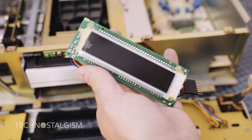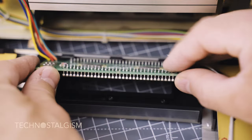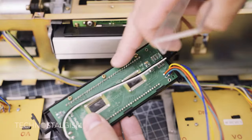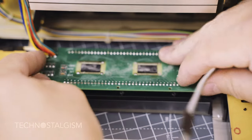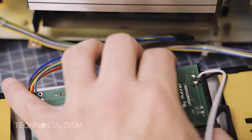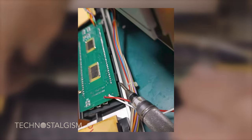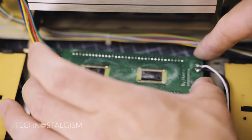With this sorted, it's time to remove the protective film and get ready to swap the display. And here's where I struggled a bit, as the new unit is a bit thicker, probably because of the added backlight. It can be pushed in with a bit of force to be held in place by the clips on one side and the screws on the other, but the board feels bent and I fear it might crack over time. After fiddling for a bit and trying to fit the board, I remembered that this is a Revox and all parts should be easily serviced. These clips allow you to fully lift the display frame, making installation much easier. The transparent front panel can also be slid off, making cleaning or even a polish easily possible. I only later noticed an image in the original listing that seemed to indicate leaving the new board above the retaining clips, but then the display doesn't seem to lay flush with the surrounding back frame.